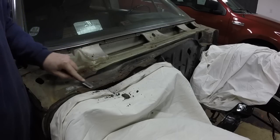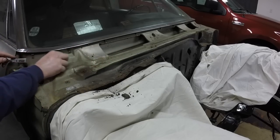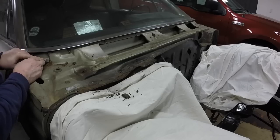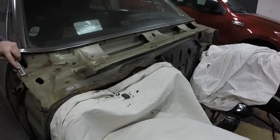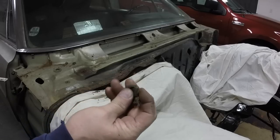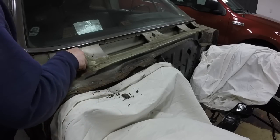Right now I'm just scraping the old seam sealer off before I sand it — you get all the old stuff off and it doesn't clog up your sandpaper when you go to sand. Where it's rusty underneath, it's because it was cracked and compromised, so it's going to leak. I'll get in there with the screwdriver and scrape it all out of the cracks. I've got to get these rubber flaps off too so I can scrape and clean all that. There's a bit of dum-dum on that joint right there — same stuff I have in that box so I can put new of that on.